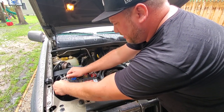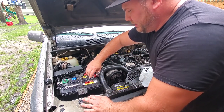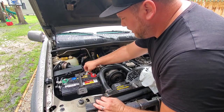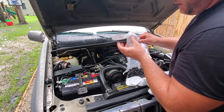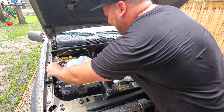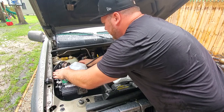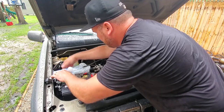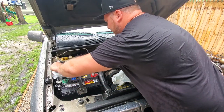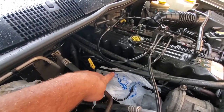First thing we're going to do, we're going to disconnect the battery terminals. We are going to be pressure washing this engine bay very gingerly, very lightly. But still, we do not want to take a chance of shorting out anything electrical. So battery is getting disconnected. Move the terminals down and out of the way. Next thing we're going to do, we're going to use Walmart bags and cover up this fuse panel and an AC connector here. Double bag it — better safe than sorry. We bagged everything on the passenger side: battery, fuse box, PCM, coil, and distributor.